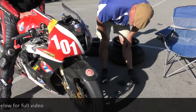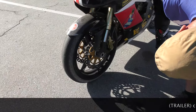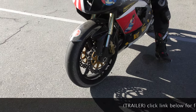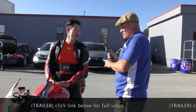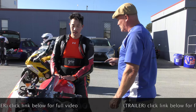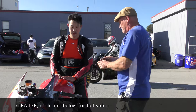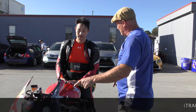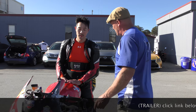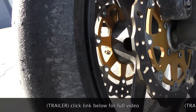You lost the front, not the rear. The front went pirouetting the rear around it. The back has no spin marks as the tire was leaving traction, but the front does. That would suggest it was the front. If you look at the rear tire all the way around the circumference, all the marks are 90 degrees to the circumference — none have any bend at all — which would suggest the front. The front could easily get those marks spinning in the gravel.